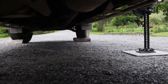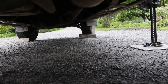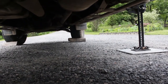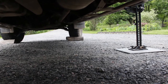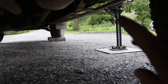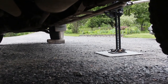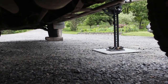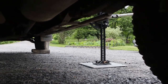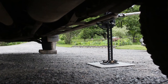Oh by the way, make sure you chock your wheels — I don't care what you use, rocks, whatever. You don't want to be crawling around under your truck with a hi-jack, especially if you're by yourself. If something were to happen, bad news — you're not getting out of there. Hi-jacks are notoriously unstable even with that base plate, which does make it a lot more stable and safe. But the upper piece could slip out — and then you're toast. I have enough suspension clearance under my truck even if it were to go right now. On the trail you've got to be really mindful and be really safe.